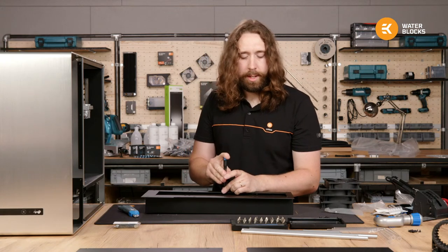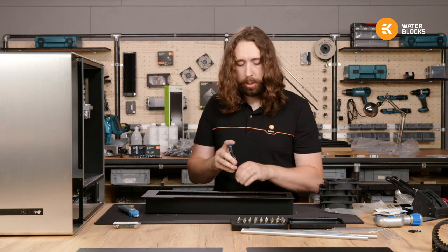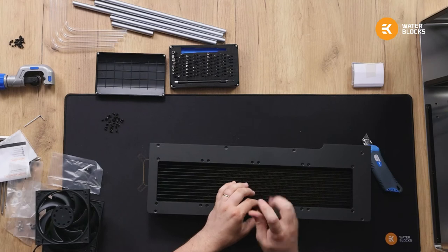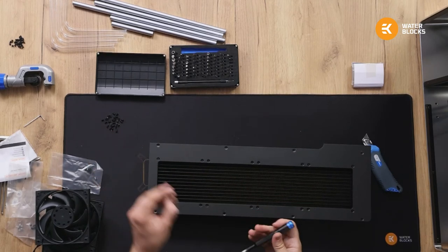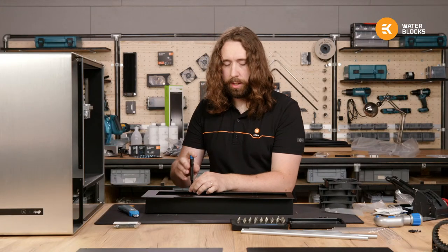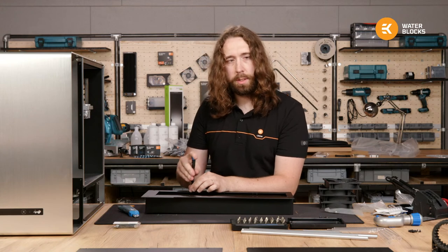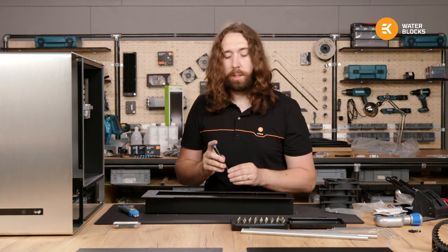And titanium is not something we've ever tried on a cold plate yet, for the reason that it's very difficult to apply for big surfaces, and it doesn't go on the inside of fittings. It's only on the outside. It doesn't wrap through every surface, so it doesn't really count since it's not inside the loop.